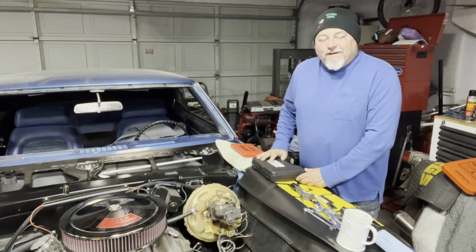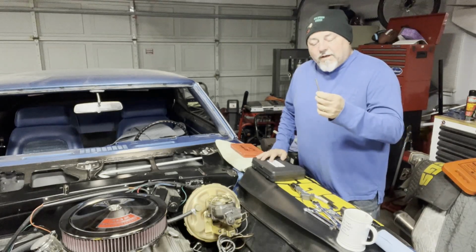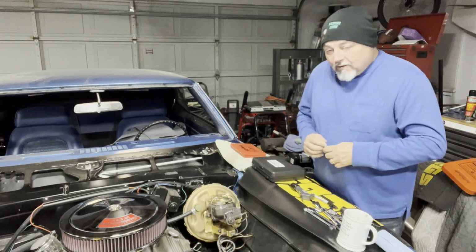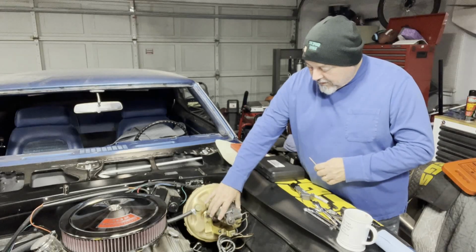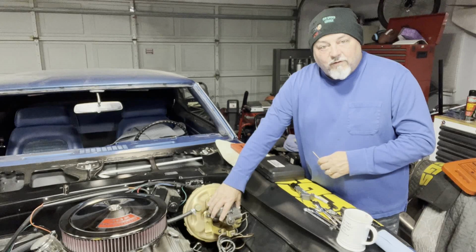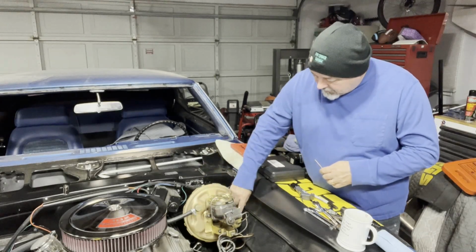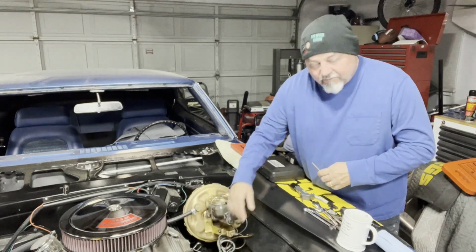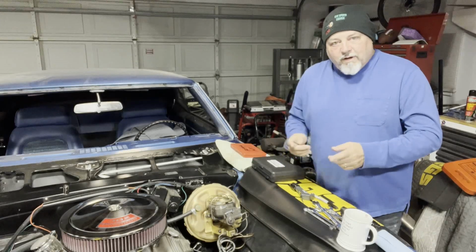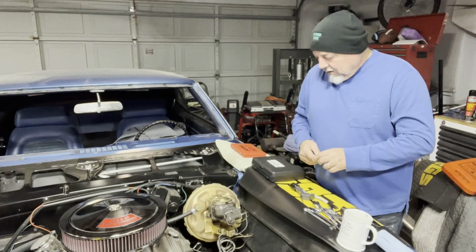Thanks for watching tonight. I'm going to do a little test flare on a brake line here. You may remember a month or so ago I've been working on my brakes and I went through and double checked all the different functions of the master cylinder, made sure all the ports were clean and open. I didn't record this, but I took the metering valve and the diverter valve off and cleaned them and made sure everything was working right and made sure the shuttle valve was working and all that, and the diverter valve.